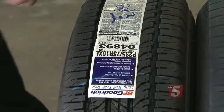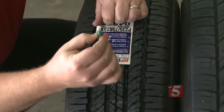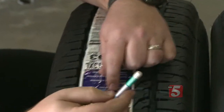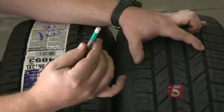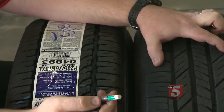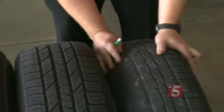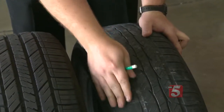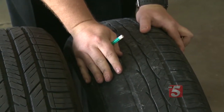Here's a demonstration about tire tread and the amount of tire tread, using a standard tire gauge. A new tire will typically come with 11/32nds of tread. This tire over here is right at 6/32nds, which would be considered half tread. And as you can see, this tire over here has some issues — not only is it worn out, but you can see the inside edge, which is an indication of an alignment issue with the vehicle.